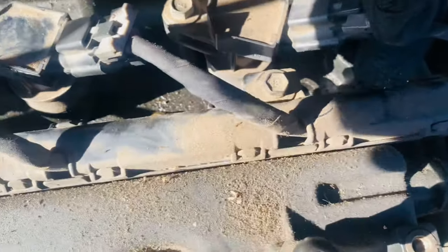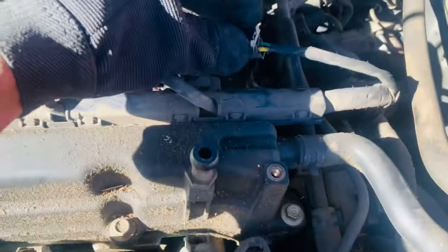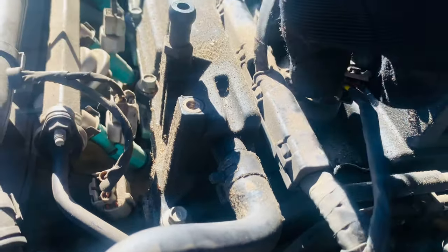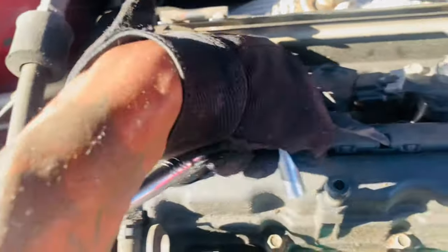When they're actually on, I'm going to show you guys carefully. These little metal brackets are here, so in order for this to come off — the little electric wiring — you have to pull this out. There you go, you just pull it out like that. Boom. Then you just wiggle this off and it comes off like that. Once you do that, get your 10 millimeter socket and you're going to take your screws out for the coil packs.